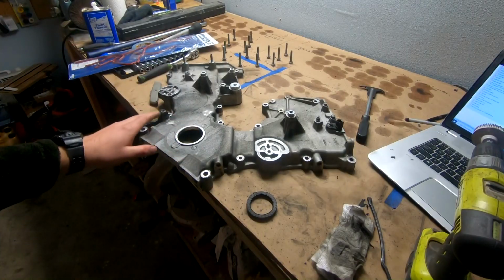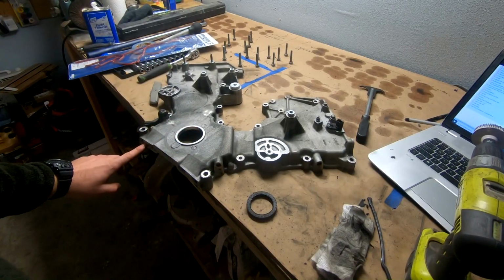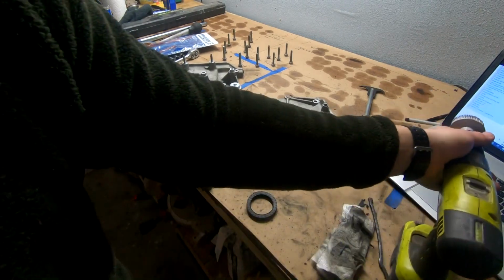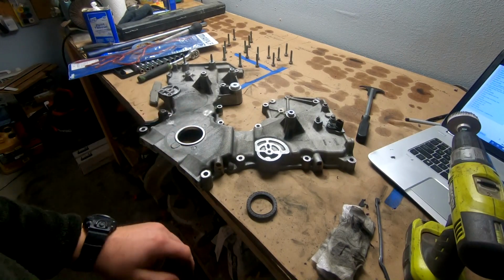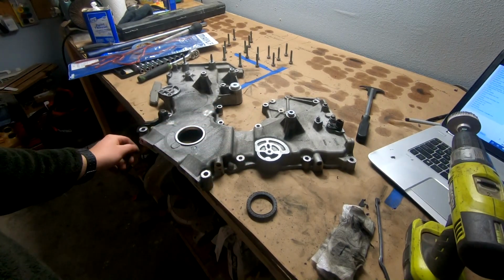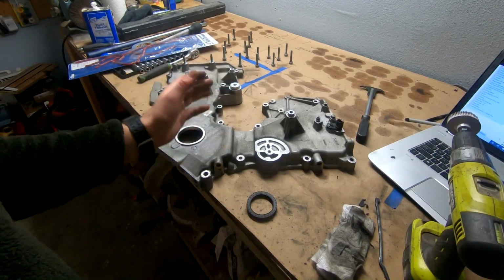All right, so as you saw, I was prepping all the surfaces. I missed this bottom one right here. I need to go ahead and get that real quick. This is just a minor abrasive wheel, and then I'm using a parts cleaner and paper towel just to go over everything, make sure we're clean. So far, so good. I used a razor blade to get off some of this thicker silicone. As long as you're very flat and don't gouge the metal, you're fine.